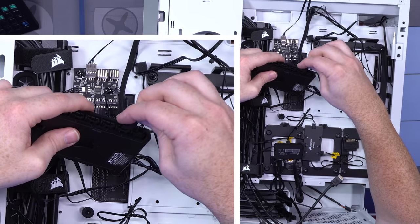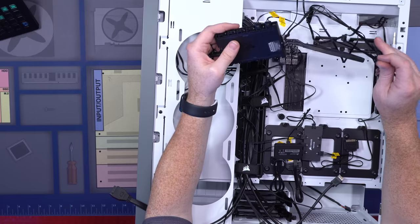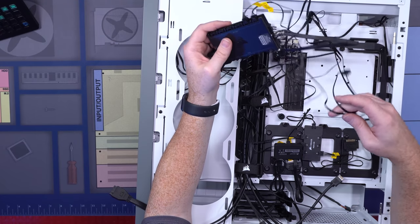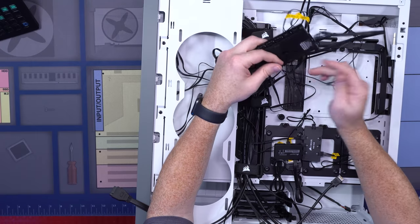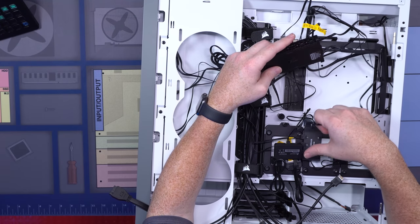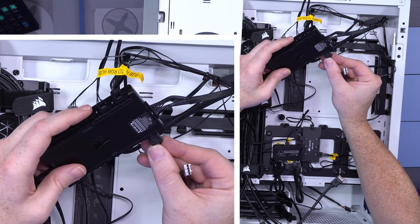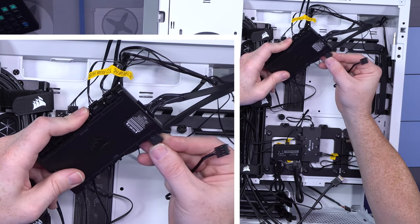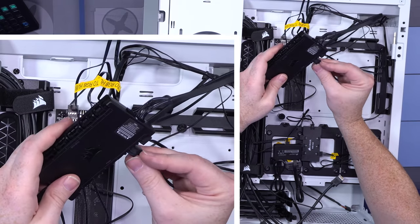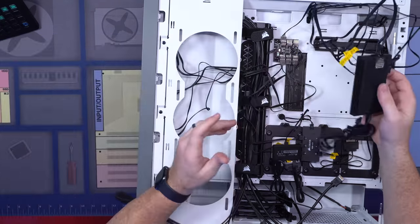And you can see why I hooked up the other ones first before hooking up this, because we don't wanna mix up these two connections. The way Corsair stuff works is it has to be the same type of fan, because these are ML fans and these are LL fans, they can't work on the same hub. Second thing we're gonna do is plug this fan into one, like so. We're gonna plug this fan into two, like so. Okay, so now we've got all that done.